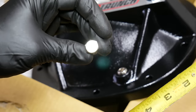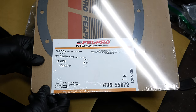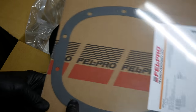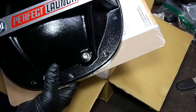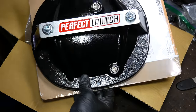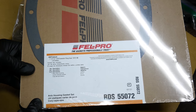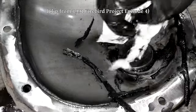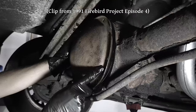With just the flat washers on them, these 5/16-inch coarse bolts that are an inch and a half long will do the trick. Instead of RTV, we're also going to be using a pre-cut gasket. The instructions for this cover mention it's probably not the best to use one, since it'll space the cover out a little bit more than RTV would. But after using these gaskets a few times instead of RTV, I have to say I like the experience a lot better, and we're just going to go with the old time-tested approach.